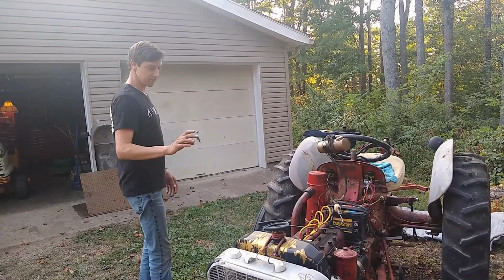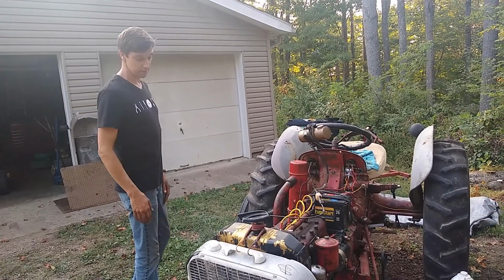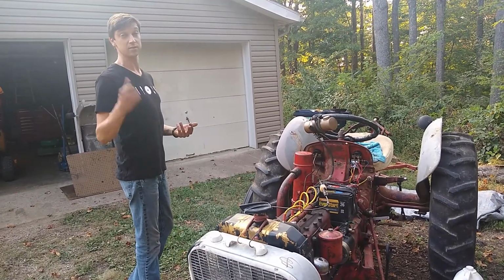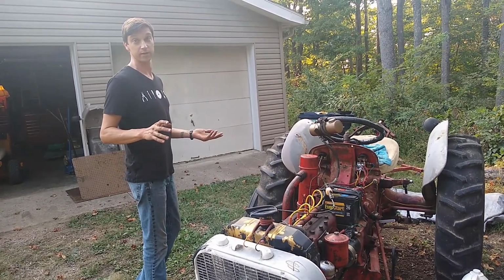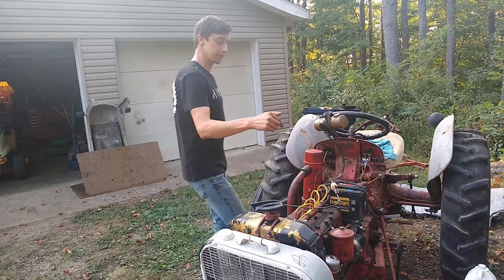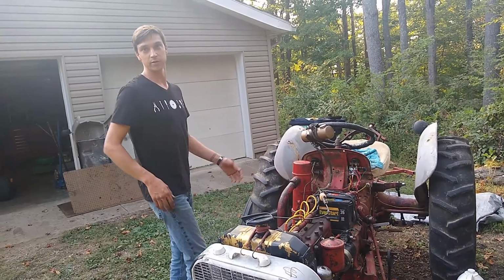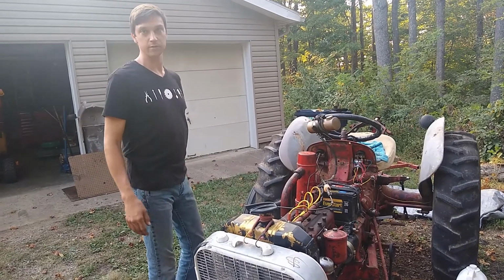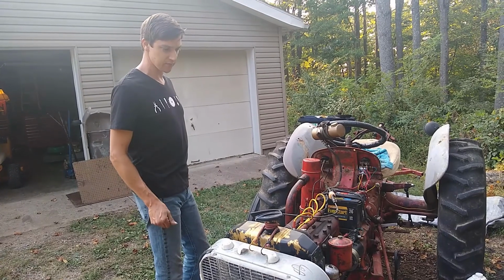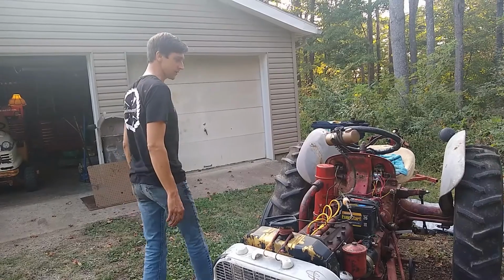So some painting was done. Now I realize that I've got to get some more engine-related parts. I've got to get a carburetor rebuild kit. I've got to get a head gasket that's decent because the one that shipped was damaged in shipping. Get some new head bolts, seal that up. I'll probably do another JB Weld repair right above that one on the block. Might as well. They don't build a lot of system pressure, as long as it can seal a leak decently. I think the cap is rated for only like 7 PSI or something like that. It's less than an automotive system even.